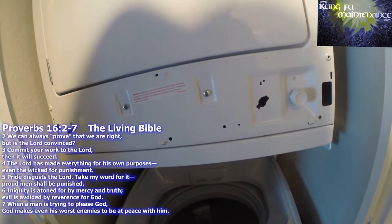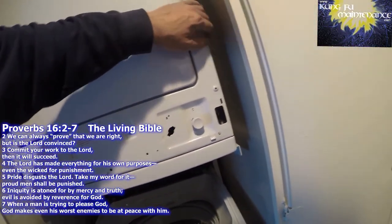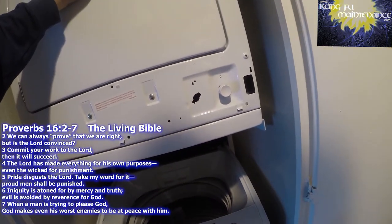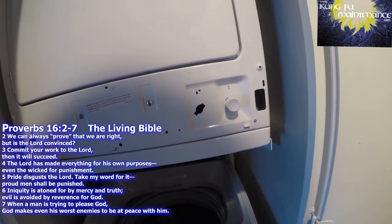This has one screw on each side that holds the faceplate in, but you'll want to turn the power off first. You can either unplug it or turn the breaker off as your options to eliminate the power.